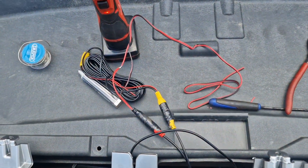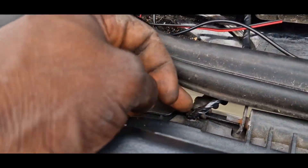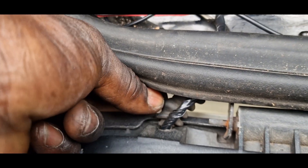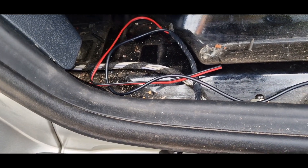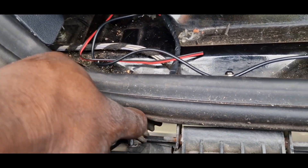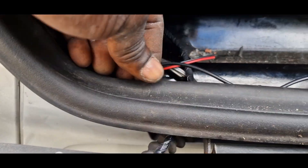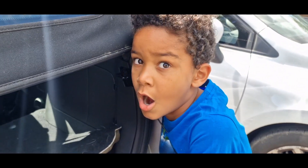I'll put the boot back together. This is a bit of wire — I couldn't get the wire through the grommet, the little rubber sleeve that I would normally use. It's too thin with too many wires going through it, so I didn't want to compromise it anymore and left it on the other side. Not the best looking thing but it's just a tiny bit coming through there. I'll pull this seal back through here. I'm going to fit some parking sensors as well.